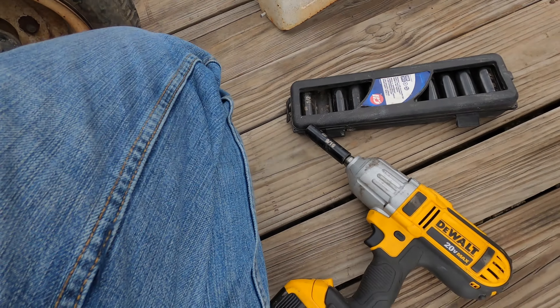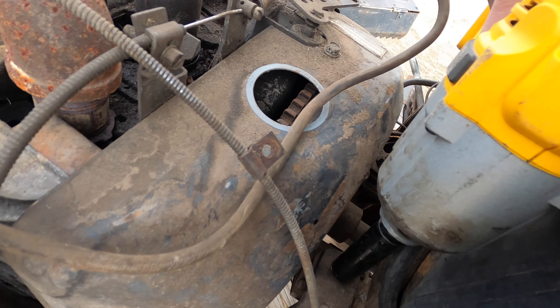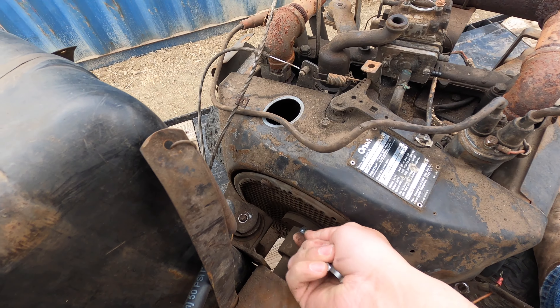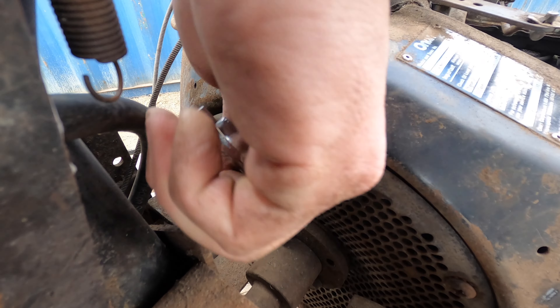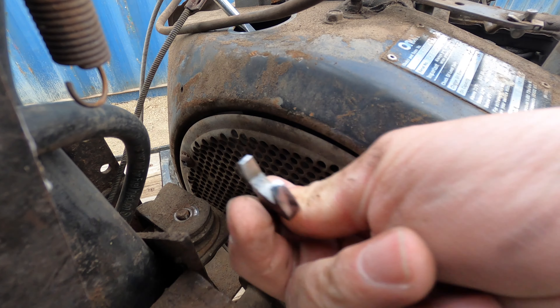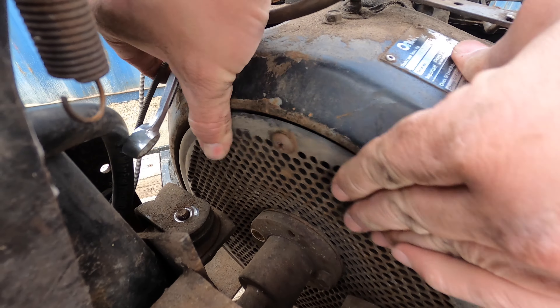Now that I'm looking at these engine mounts and where they're at, it's going to be really difficult for me to get wrenches in there plus a camera - there's just not really good room for both. So I'm going to remove these four nuts; that's what's going to release the engine and I'll show you as we pull it out. Second thought - now I'm starting to remember some things. I'm going to release the engine mounts up at the top four points and we'll pull the whole cradle out.